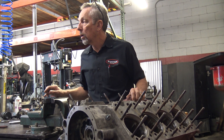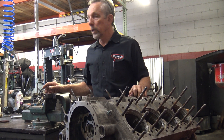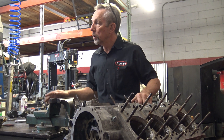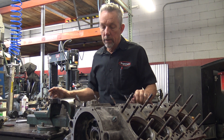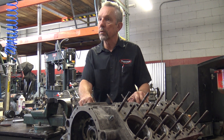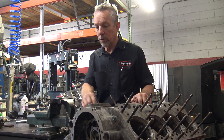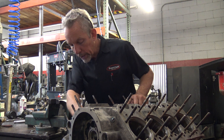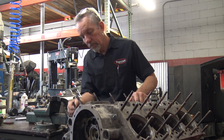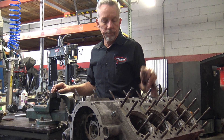So I've seen a lot of attempts at that. That's why they would add weld to all of the bearing journals and then re-bore them — that's important because it's going to be square and true. And remember, you've got all these steel things in here that you can't really pull out effectively, so they're going to suck up a lot of heat. And if you do something like that and it doesn't work, you're really screwed.